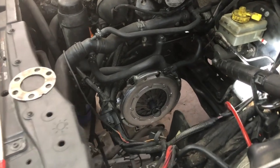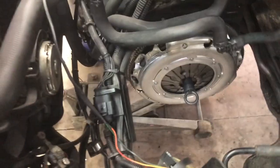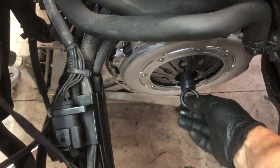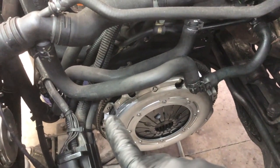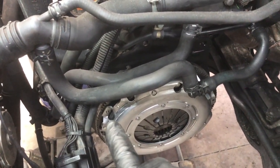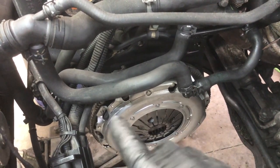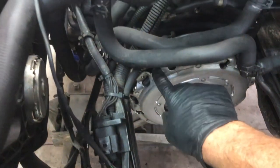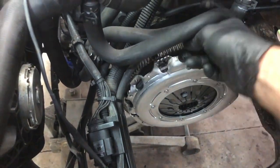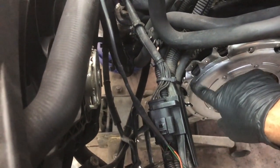Alright, looking down into the engine bay, kind of looking over everything before I get ready to hoist the transmission up. I need to remove my centering tool from the clutch plate. Again, torque to spec. In this engine it was 20 Newton meters on the 6 bolts that hold the pressure plate on, going in a crisscross pattern, and again I will recommend using a little bit of Loctite. Check the edges here that it's sitting down properly and that you are engaged on the centering pins. There's a centering pin there. I'm sorry, right here. Alright, so that's the clutch.